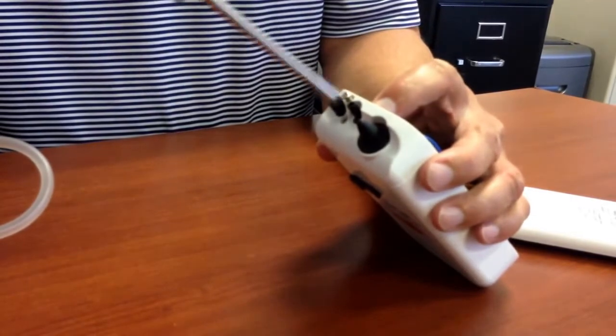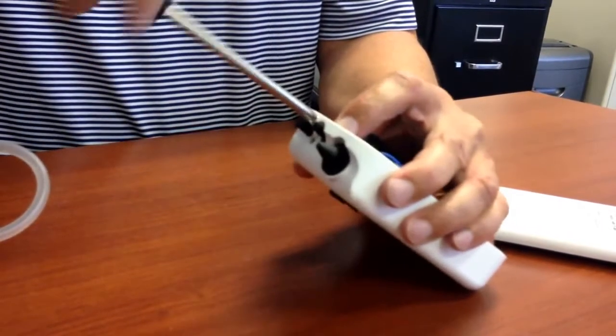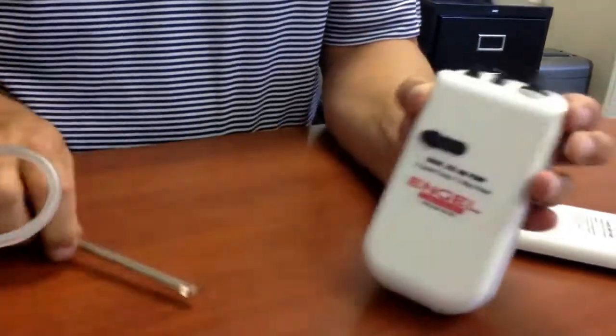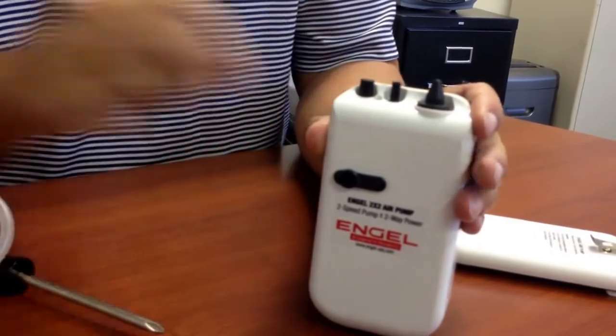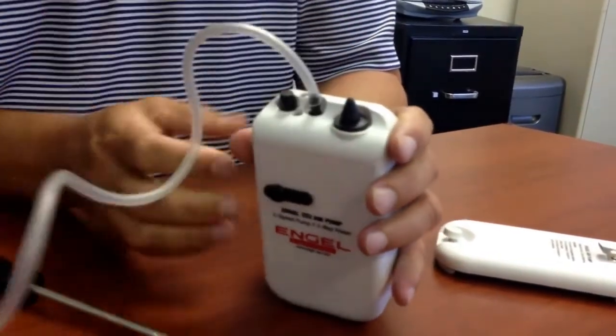Also, once again, do not over tighten, otherwise you close everything up inside and it makes it a little bit more difficult for everything to operate. Just cinch it down, take up the slack. The air intake should be completely free and sticking up like that, approximately the same height as the outlet. Without putting the whole thing back together again, we should check it one more time.